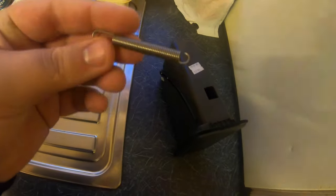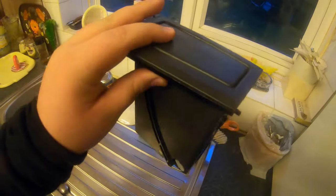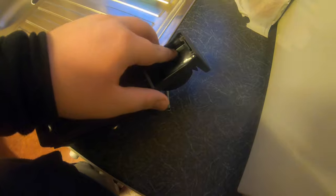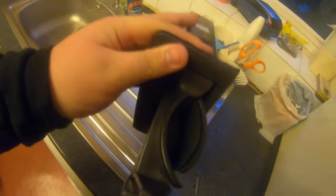Here's the spring — it broke. If you have it upwards like that it's not going to work, so you need to turn it this way. That spring is meant to attach there — mine's broken and that bit's snapped off. That's the whole reason this doesn't stay in, because that bit controls that mechanism. You can see when you move it, the cup holder arm moves — it's under tension all the time.